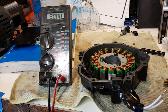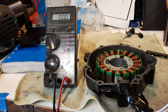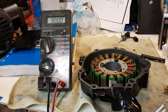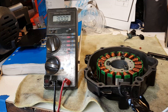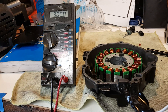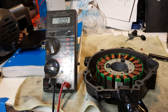And then there's your battery. If you're experiencing an issue like I am, where your battery is not being charged to full capacity, or if you're not seeing 14.2 to 14.5 volts — if you have a voltage meter on your bike like I do — during your ride you're supposed to be seeing at least about 14.2 to 14.5 volts at about 5,000 RPMs or above.